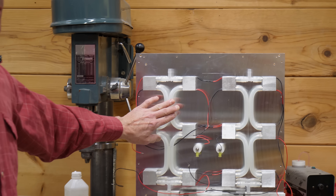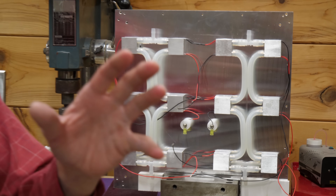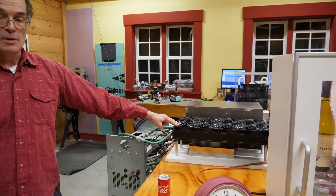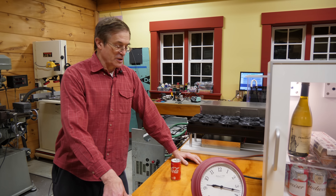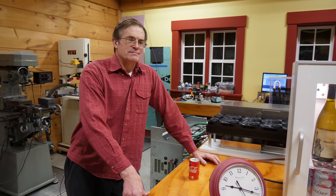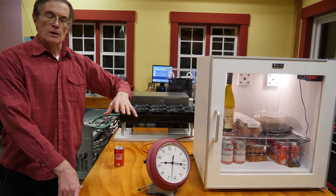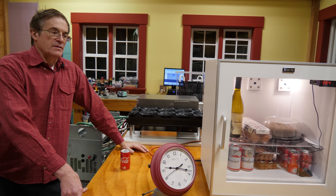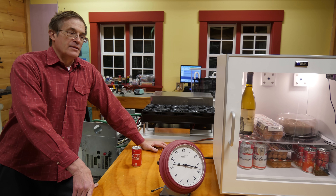The reason that that is intriguing is because we can isolate the fan noise from the refrigerator and bring the heat to another location — allowing us to draw the heat into even another room if we chose to do that. So the radiators are going to be remoted from the back of the freezer device. It also allows us to incorporate a potential energy saving principle. In New England it's winter at least six months out of the year, and it is kind of ironic that we're building this device to keep things cold in a room that we are trying to keep warm inside of an environment which is cold. So we're going to use a neat technique to hopefully increase the efficiency of the device by taking advantage of this remote cooling system, and we're going to be showing you that in the upcoming video on the solid state freezer.